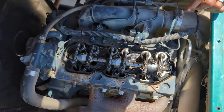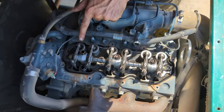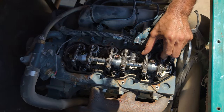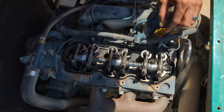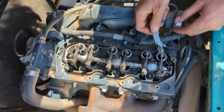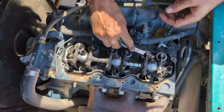Our intake's down. We're expecting to come around and then I should feel the compression. It actually bounced back because you could feel the compression on this — so we got good compression on this engine. Now this one's starting to open its intake and this one's exhaust. Now it wants to turn over — we should be top dead center on this one. You could also mark the flywheel and actually look to see that you've rotated one whole revolution since opening the intake. So we should be very close to TDC. Now that one feels a little loose — this one feels a lot looser than the other one. That's why we do this, because we really want them all operating the same. There's a lot of wiggle room in here, so this one needs to be tightened up.